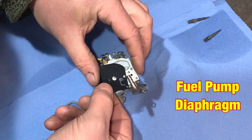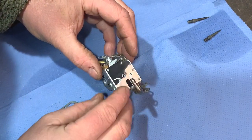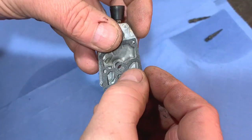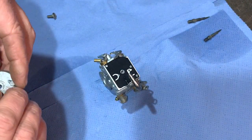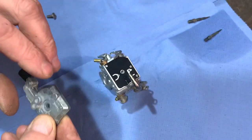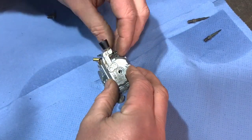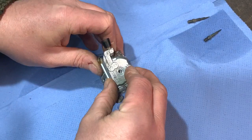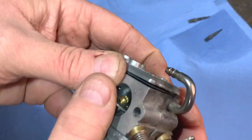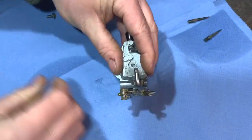It's a little bit trickier on this one than normal because that pipe is there. It's on there. I'll put the gasket on that part and try to get that in place, then get a little bolt through there. There are some little locating tabs on there which helps. I've just moved the throttle bit away a little just to clear — there we go, it's all down.